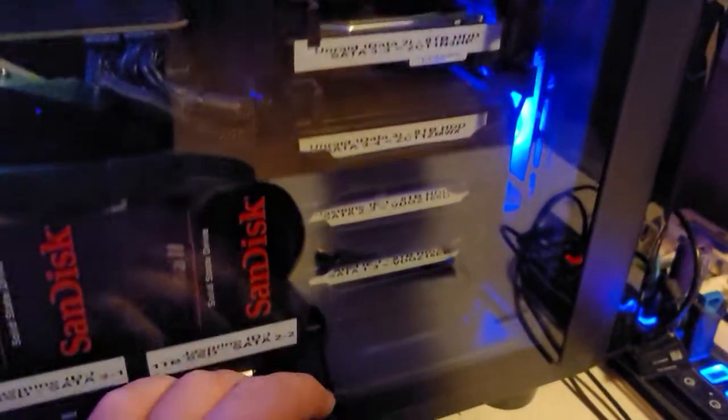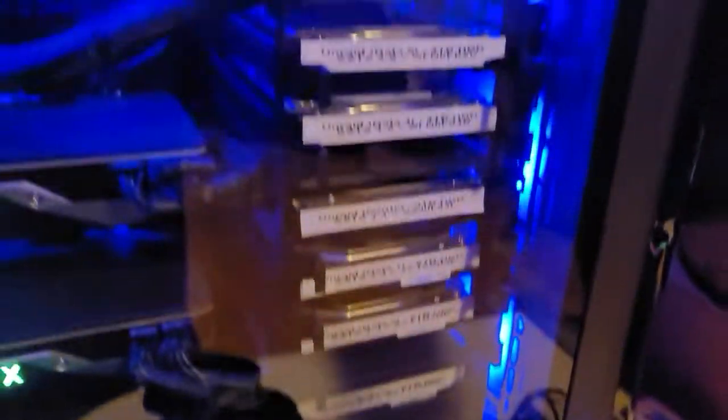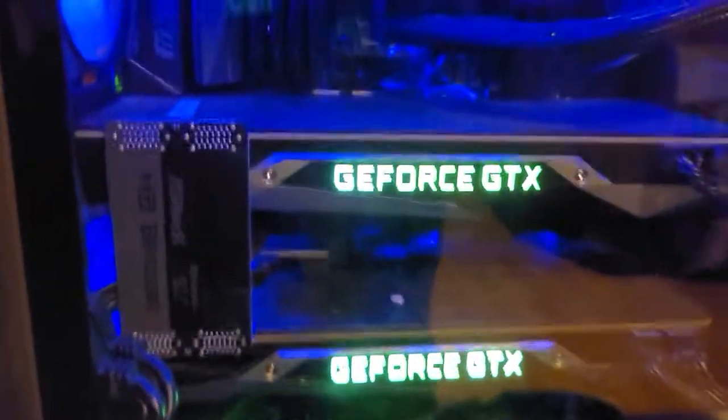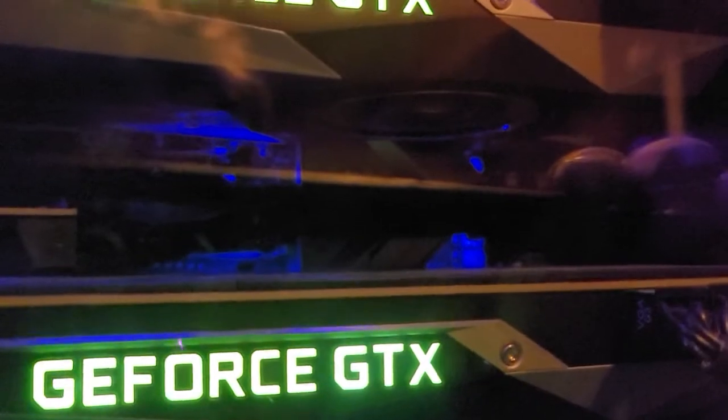With my case airflow, I've got three fans in the front and they draw air into the front over my hard drives. My hard drives can get warm, especially if they're working in the array. I've got two video cards, 1080 Ti's — they're heat monsters, but they are the reference series with a high-speed blower. That draws in from the bottom and expels the heat out the back of the case, so fresh air comes in and draws back out through the video cards.